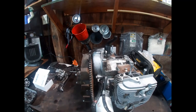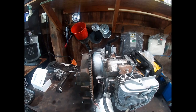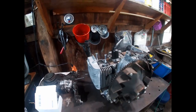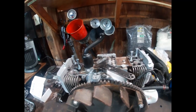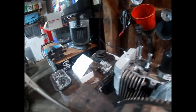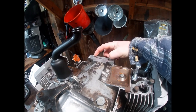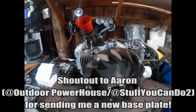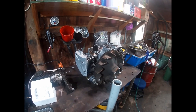I checked to see if this had the plastic flyball spacer, but being an '85 build it has the metal one, so that was no concern. I replaced pretty much every gasket and seal — the intake and exhaust manifolds will be getting new gaskets when those go back on. I also have new gaskets for the points and a new set of points in the box, but in the process of putting the points back on, I actually broke the base plate that the points attach to, so I'm waiting for a new one of those to come in. But other than that, it's coming together very well and hopefully within the next week or so this thing will be making some noise.